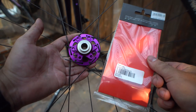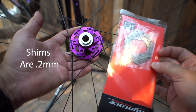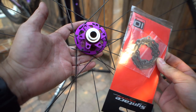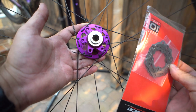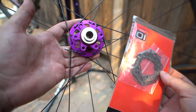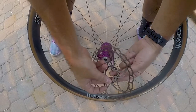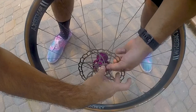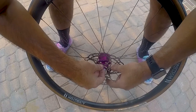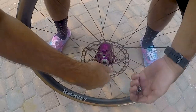I would always start with at least one or two shims — these are either half millimeter or 0.25 millimeter, I'll put it on screen. They're very thin and won't add a lot of thickness since you're talking millimeters inside the caliper, so do this little by little. With how much the rotor is contacting, I'm going to start with two. A tip for six bolt shims: thread the bolt through your rotor, then through your two shims, orientate the wheel at the top so they hang nicely for easy alignment. Start all bolts finger tight, then tighten with your tool of choice.